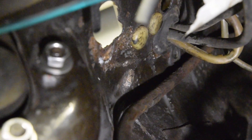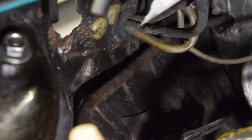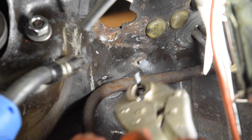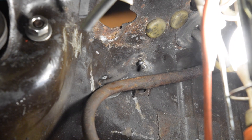It might be quite hard to see, but behind the brake booster there's a sheared-off stud that holds the accelerator tube. You can see that tube coming through the bulkhead - it has a little stud that just holds a clip, keeping it tight to the engine bay. I'm just going to try and weld one on there now. There we go - that's pretty well on there actually.